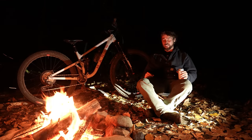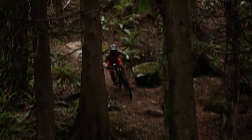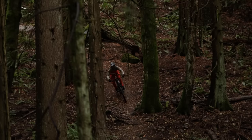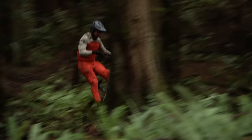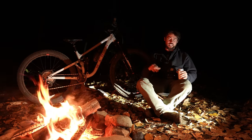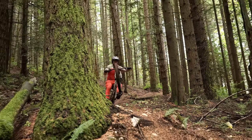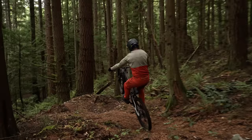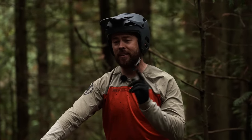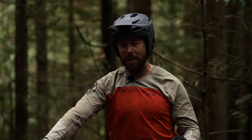So those stock brakes, they're Shimano MT-201s. They're just two piston. I went and bought some MTX Gold, I wanna say, more aggressive pads. And then I used proper Ice Tech rotors, upgraded those. Both of these are substantially more expensive than the stock setup, but I was doing all I could to get the brakes to work better because I couldn't really stop with one finger on the brake levers once I've been going down a steep hill for more than, like, I don't know, a minute or whatnot. And with that combination, aftermarket metal pads and Shimano Ice Tech rotors, the brakes are working better.